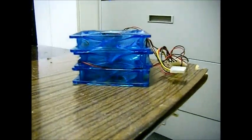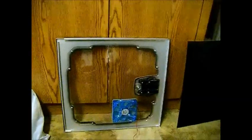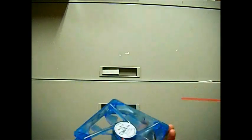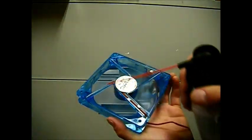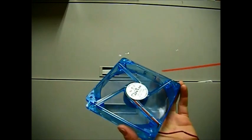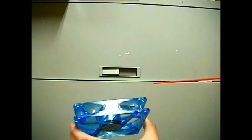We took out all the fans except the one up here, which I don't really mind since it never really gets too dusty — I spray it once in a while. So we got three 120mm fans. What you want to do is get the can of dust off and pretty much spray the fan like so. You're not going to get all the dust off of it, but you want to get as much as you can.